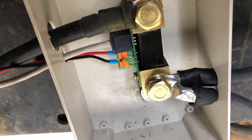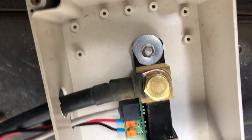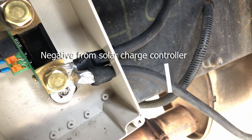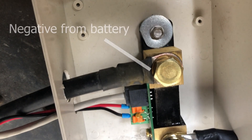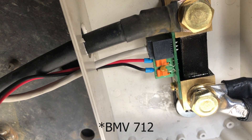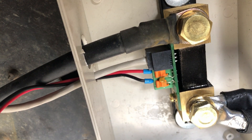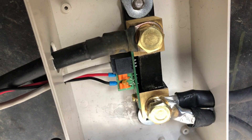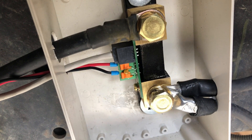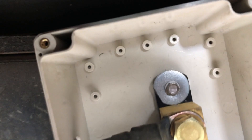This is the shunt box. The shunt should be shielded, and I didn't know a good way to mount it inside, so I bought a project box off Amazon and mounted the shunt in it. I've got a wire going to ground, the ground wire from the solar charger to this end of the shunt, and this end is the negative coming from the battery — so all this is negative. The red and red-and-black wire are the temperature sensor for the BMV712, which lets me know the battery temperature. The white cable coming in is the COM cable for the battery monitor. It has some electronic circuitry and isn't outdoor-rated, so that's why it's in this box. The box is watertight — I'm going to seal these holes with silicone and get it all buttoned up.